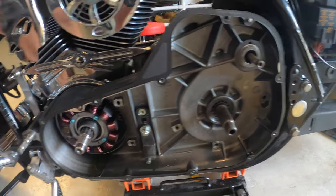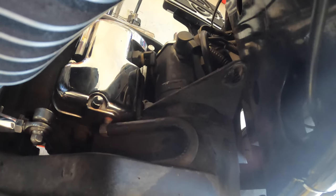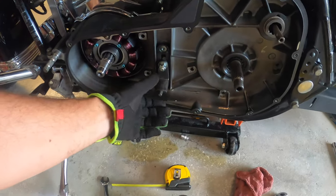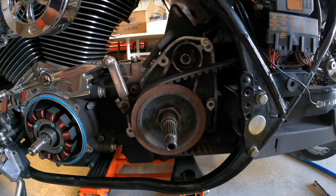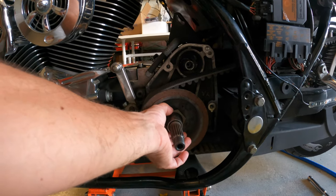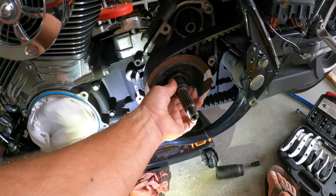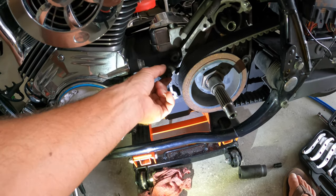Since we're dealing with the starter and neutral electronics, I'm going to disconnect the negative side of the battery — I have a lot of accessories on this bike. With everything cleared away, I'm going in to take the two hex cover bolts off the starter, which should allow me to take the whole cover off. I've also taken off the tensioner — I just removed the snap ring and took off the retainer plate. The main shaft nut is one and seven-eighths of an inch, which is quite large.